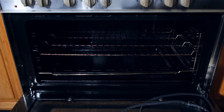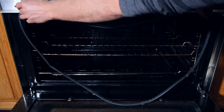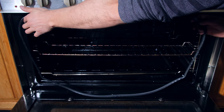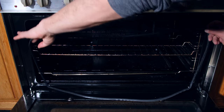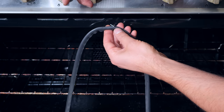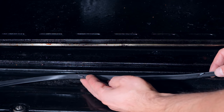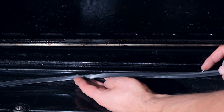Once you're happy with the surface preparation, I can now hold the new seal and just check that the alignment is correct. I hold the seal in place to determine that the orientation is correct. This is a rectangular seal. The seal is directional because on the top there's one hole — this spur-like metal piece sticking out goes into the hole. But on the bottom I have two holes.